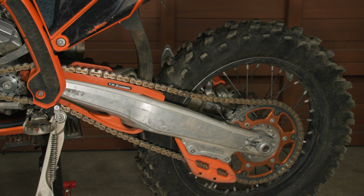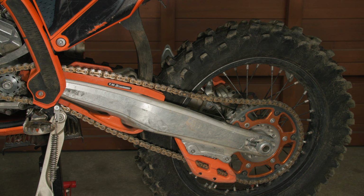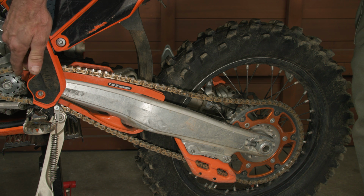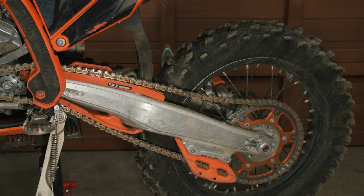One reason I made this video is someone called Speed Demon Express commented on a previous video I'd made, which was of a Riding Buddy's TPI, which had the cases cracked in this area. That was due to excessive chain tension. He basically had no slack at all, put a lot of force on the swing arm pivot and cracked the cases. I'll put a link in the description of this video in case you want to watch that one.